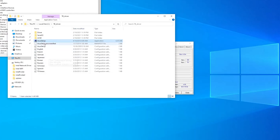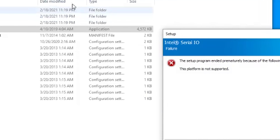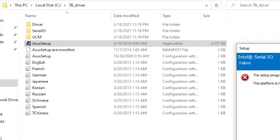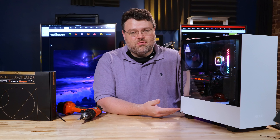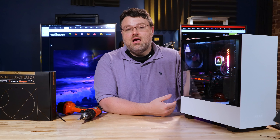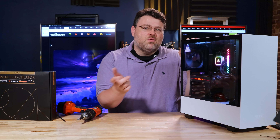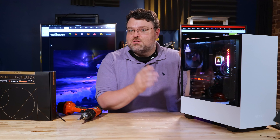Even installing the ASUS drivers from the ASUS website immediately pops up from Intel saying this isn't a supported platform. But ASUS has apparently done something to the installer — you get a couple flashes of black screens and then the installer continues. The control utility still works fine, even though the Intel installer says it's not a supported platform. I don't think it's really unsupported since it's certified Thunderbolt at this point, but it is one of those weird things. If you've got some older Thunderbolt peripherals, it may be a little problematic. In my experience the DCH drivers from the Windows Store are a little less polished than the ones you can otherwise get online. There's a component to the drivers in what you downloaded from ASUS, but then the GUI for managing it comes from the Windows Store — it's a very weird situation Microsoft is forcing on us. Or we could just run it in Linux where it's basically plug and play and a little easier to deal with.